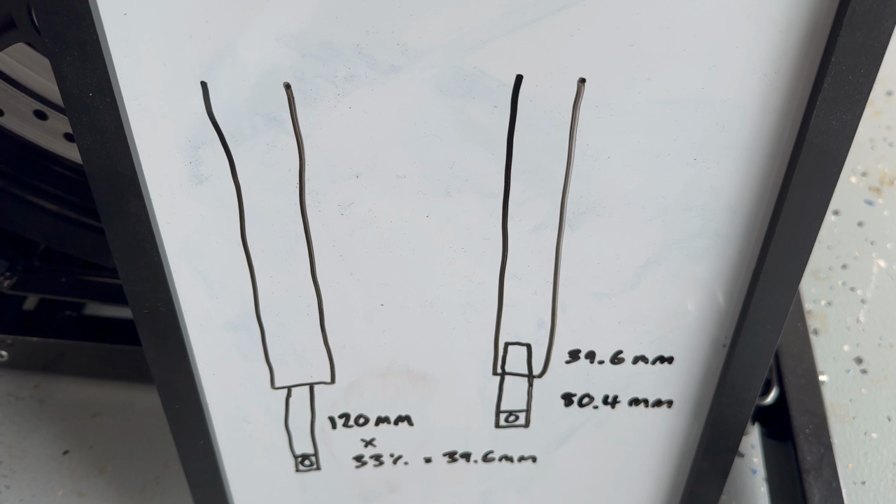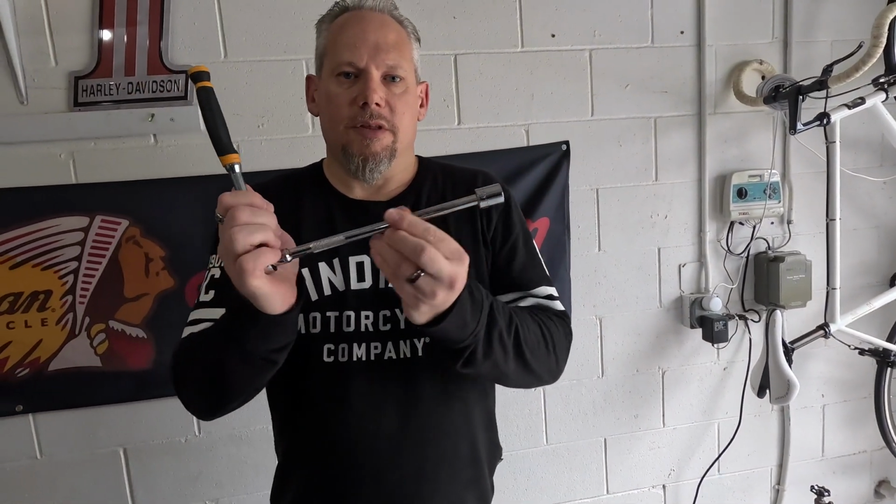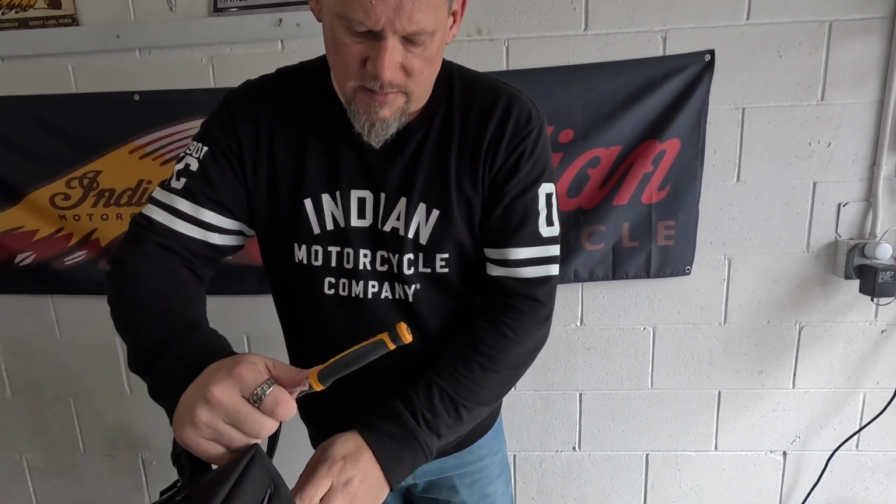So we're going to measure that a couple of ways. Again, you're going to need to have your rider with all their gear on the bike. Now the best way to do this is actually with an extension on your socket with a 17mm bit. Normally this would sit on the nut, and one full turn is what we refer to as the socket going all the way around. So we talk about the number of turns we're changing. Because we're measuring, it doesn't matter so much, but I like to still adjust by one turn as we go. The reason I can't use this is the longest extension piece I have, and because we lifted the bars on this one up, it won't actually clear and do a full turn. So I'm going to go back to using a regular wrench.